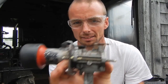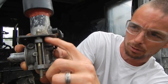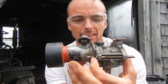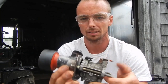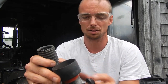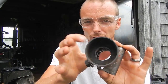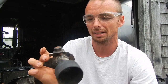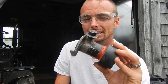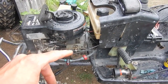This will attach like that — the studs pass through, you have enough room to screw your bolts down and still avoid hitting the bolts underneath, which is kind of a pain. So basically the whole thing bolts together like this, and what this does is it allows you to add whatever you want — like a universal intake off the end of this plastic tube. This was the end piece to a shop vac, the part that the hose used to attach to. I removed that piece, slid it into my piece of exhaust tubing, and sealed it with RTV silicone. It's pretty simple now that I've described it, but it took me a couple of days to come up with this.